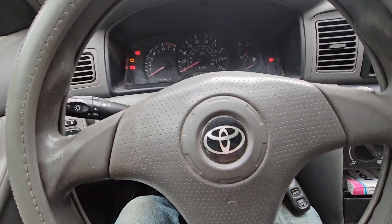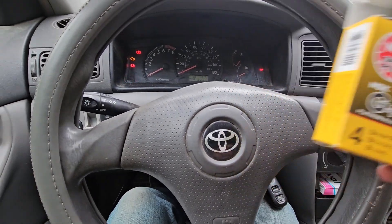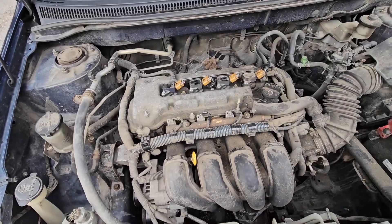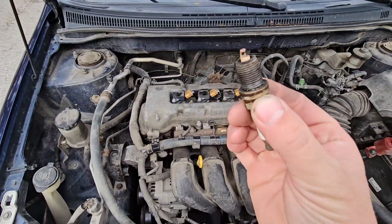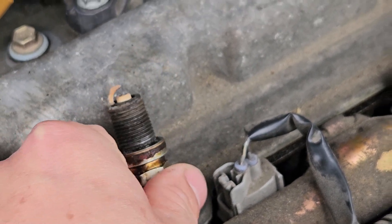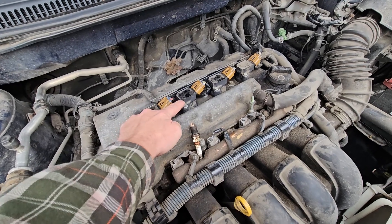So the first thing I did was put some new spark plugs in — that's pretty easy to do. That didn't fix things. So I pulled off some stuff, pre-loosened of course, unplugged these little guys, took off the ignition coils, and I changed each of the spark plugs. I'm glad I did because as you can see they were pretty worn down — that's the worst one out of the four. But that didn't fix things and cylinder two was still misfiring.